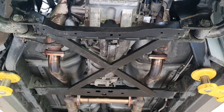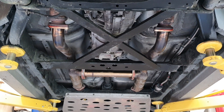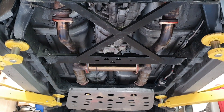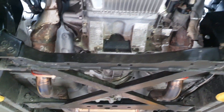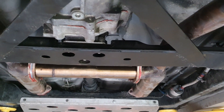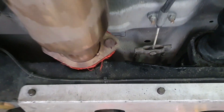Strangely, the exhaust system — if you look at the balance pipe there on the left hand side of your screen, you'll see there's an extra piece of metal in between the two flanges. The exhaust system ended up being too narrow at the back of the car, with no flexi couplings. There must be some discrepancy in the width of the cylinder heads at the exhaust flanges between the DD and the DE. So when I put the DE one on, it wound up hitting up here on the chassis, and it actually doesn't look that much better even with my spacer.